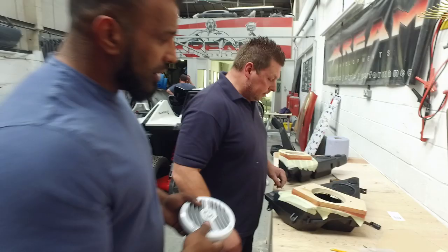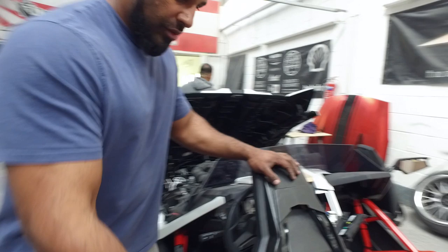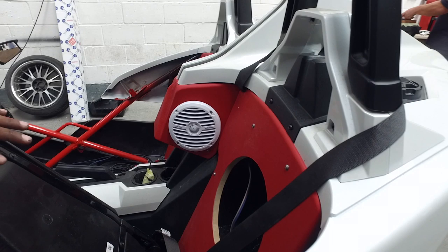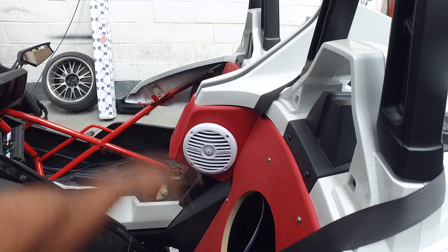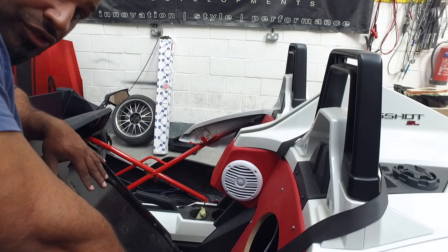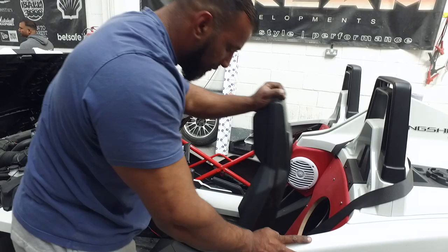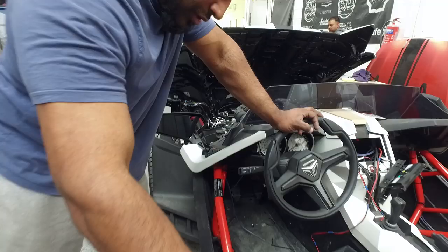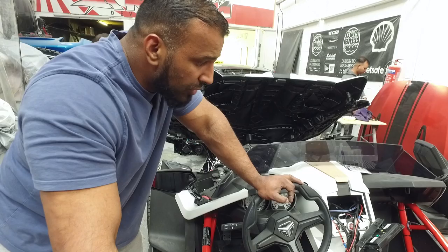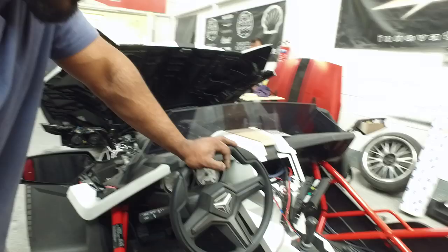The install is pretty much complete now. The panels are in, all bolted in solid, sealed in as well. The luggage compartment has now been transformed into a subwoofer enclosure — both sides — made from scratch. Everything's marine grade. A couple more amplifiers to go in — one down here, one on the other side. Subwoofer and 4-channel amp, of course, all waterproof. All the wiring's been run — all the cabling for the amplifiers and the head unit. We've had to install a line-out converter for the head unit as well, so it enables us to fit the amplifiers. Once that's installed, this will all go back in like so.